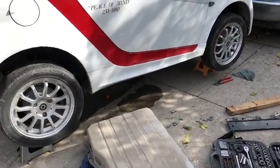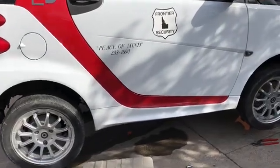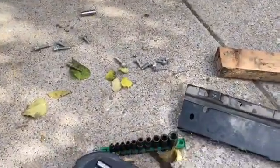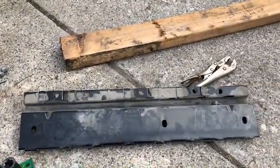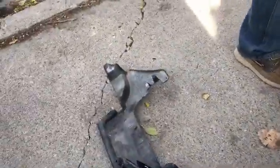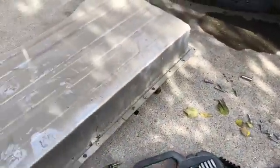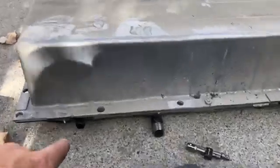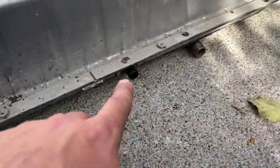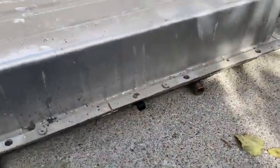To take the battery out of this little Smart ForTwo car, you're gonna need some Torx bits like those ones right there. There's a plastic plate underneath that you take out, and then there are a couple of coolant ports that you can see right here.